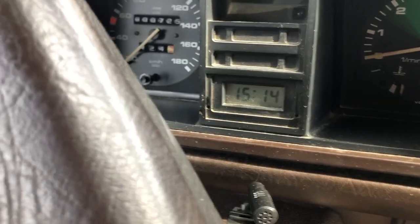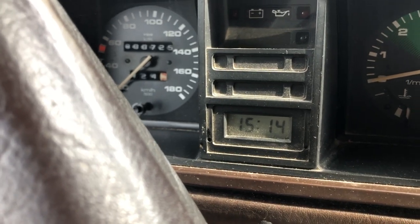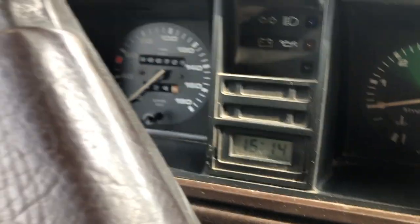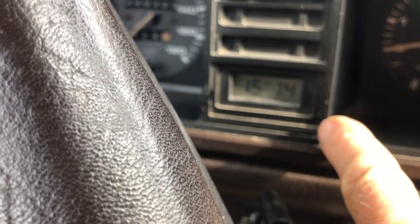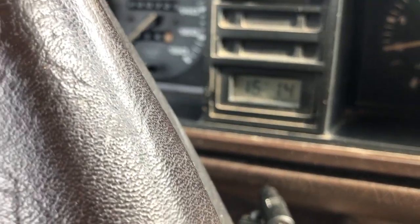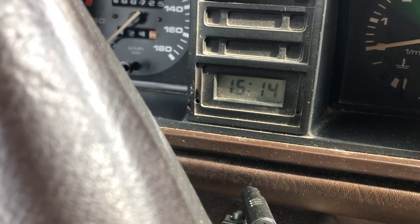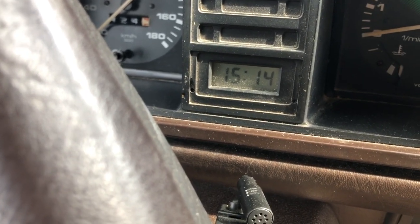I have this digital clock here, which was nuts staying on time — always changing the hour. I took it apart several times. I think the problem was that there are too few holes to adjust, and if you depress it too far, that little rubber gets stuck. So you go in there with a pin and a flashlight and just pull it back out. I put in a little silicone grease to make sure that didn't happen again. Fixed the problem.